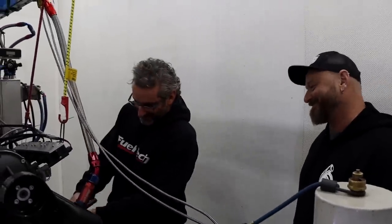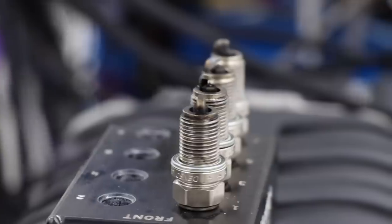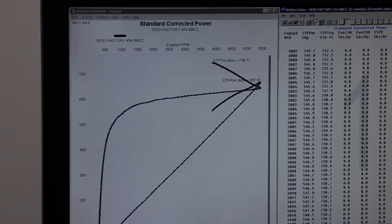This is Frank everybody. If you're in the Australian car scene you'll probably know of Frank anyway - he's a bit famous on the internet around these parts. So what's the course of action from here Frank? We're going to have a quick look at the plugs and just make sure that nothing got hot. The CAD plating is still on there. It's not the best start is it? These things happen and when you're pushing the boundary on stock parts, things are going to happen. Even though there wasn't much revs in it, maybe there was a lot of torque going through the engine - like 740 foot-pounds of torque. We know there's something broken in the engine but once we pull the sump off we'll have a look. I suspect it's probably a rod or a rod bolt - it sounds rod-related.